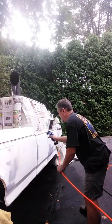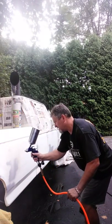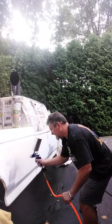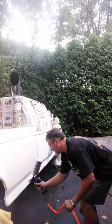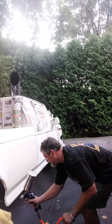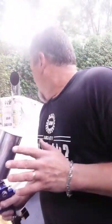We're going to make some passes here and see how this turns out. As you can see, my air compressor's running so it's hard to hear. I'll slow up a little bit — you can go faster or slower. You can see what the material looks like when it's getting put onto the panel. If it looks real heavy, you can either adjust your gun or spray faster. If it looks like not enough, you can either slow down or have more material come out of your gun. That right there looks pretty good, so I'm going to leave this setting where it's at and we're going to paint the rest of the truck.